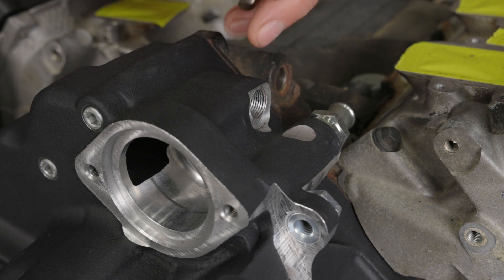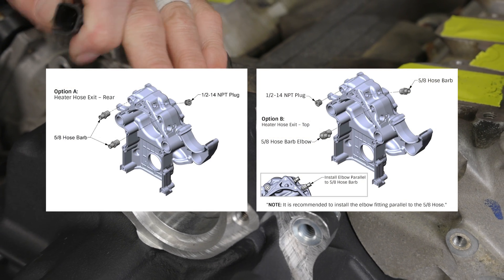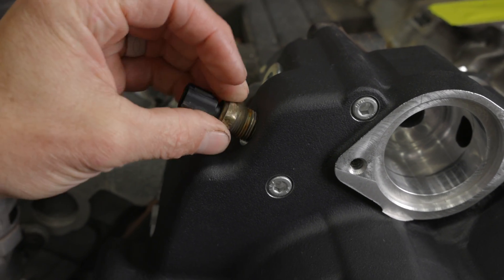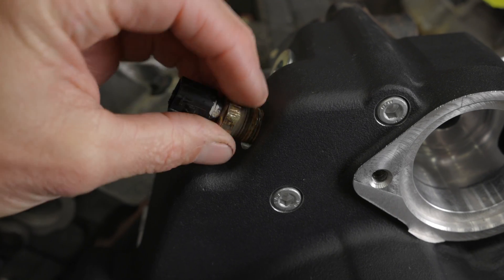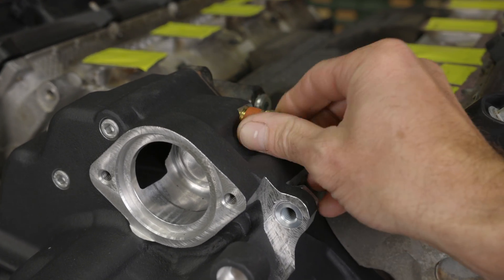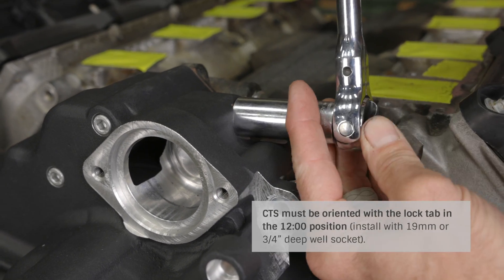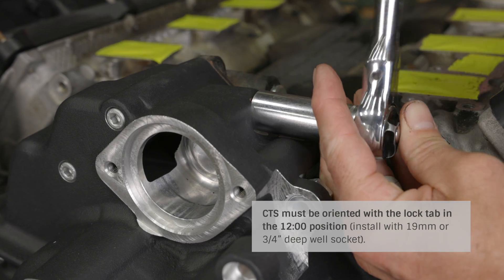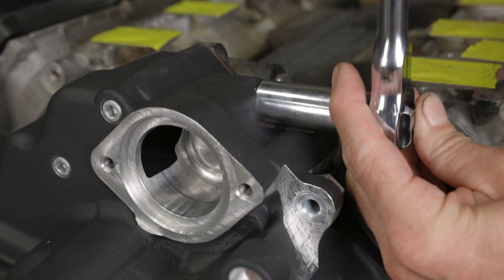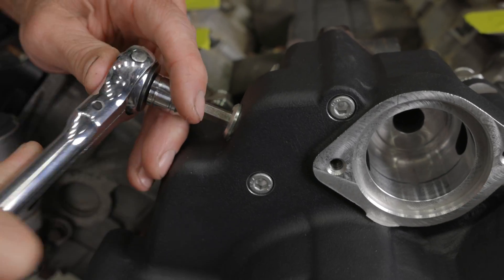Option 2 is to use the port located on the driver's side of the timing cover, and this is compatible with both heater hose routing options. Option 3 puts the coolant temp sensor on the passenger side of the timing cover — you can use either heater hose routing option with this location as well. I relocated my coolant temperature sensor from the stock location in the engine block to the port found behind the thermostat in our new timing cover housing. A new coolant temp sensor is not included in the kit; you can either reuse the old one or purchase a new one. Be sure to plug off any ports that you didn't use with the supplied plugs.